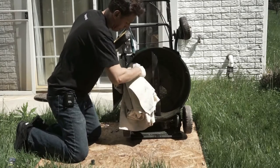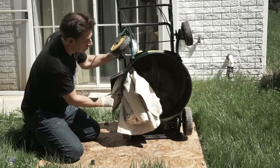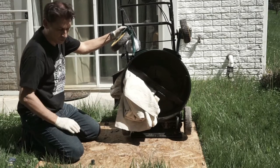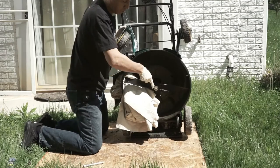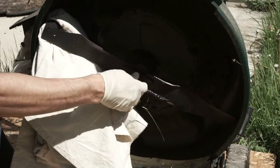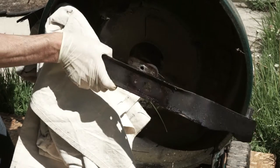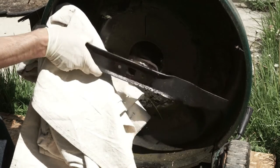What I do is I put a piece of fabric — this is a painter's or mover's rag — you pull it through the hole. This way, when it goes to turn, there's resistance and you can then turn the bolt. You could use wood or other items, but this works very easily. There you go, it's coming off really easily. And as you see, it comes off pretty easily — there's a long bolt. And there's your blade. Remember, this thing goes counter-clockwise, so the sharp edges are going this way.